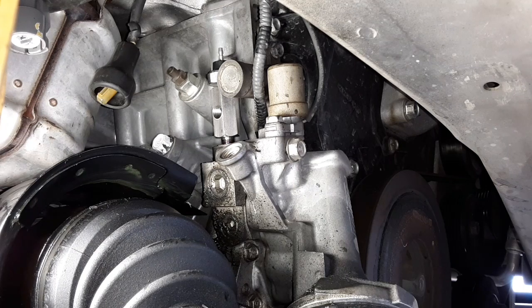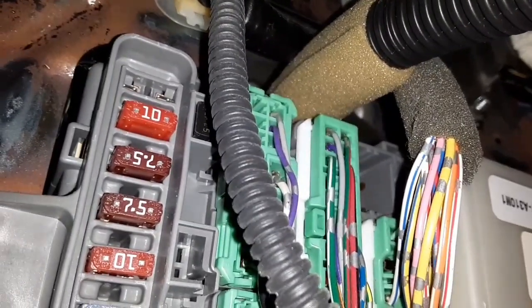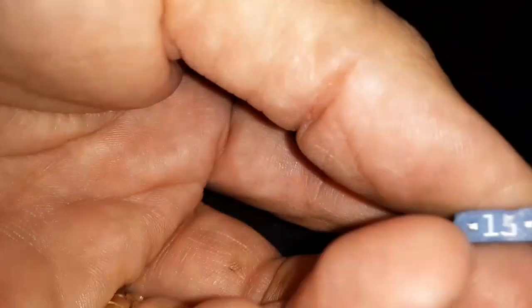I'm going to stop right there and not try to turn it anymore. What I'm going to do is connect some hoses, then hopefully disconnect the fuel pump relay, have a helper turn the key, and see if we can pump out any contaminants. We're in the Honda Pilot — you can see number one, 15 amp fuel pump right down here by the pedals next to the parking brake. I already pulled that fuse — the very top one above 10.